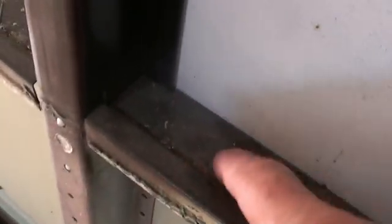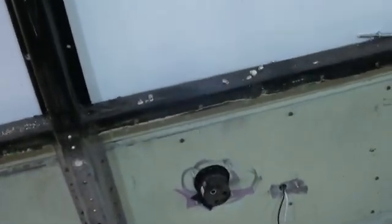I'm poking these holes so I can run the wires through here and hook them up, because there's going to be plywood against this, and I don't want to pinch the wires. And also, it's going to be my 110 volt hole. I'm going to run my 110 volt, put in a couple of outlets. I'll drill through this here, put the outlets up high, that way when I build, I don't cover them up with anything. And then my shore power will run from there through there.